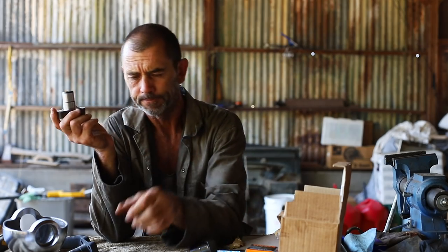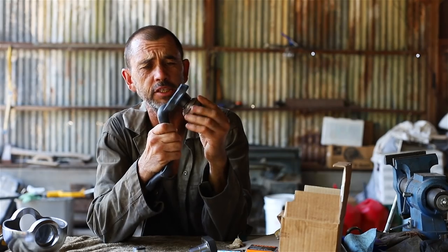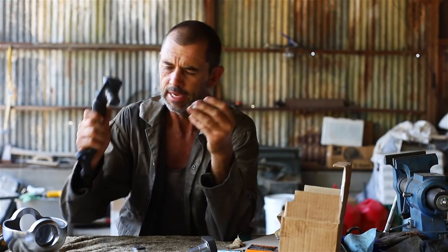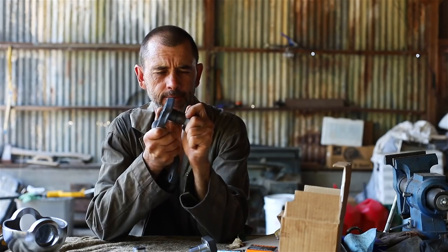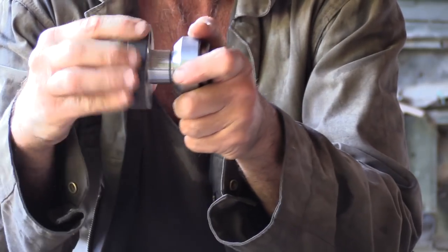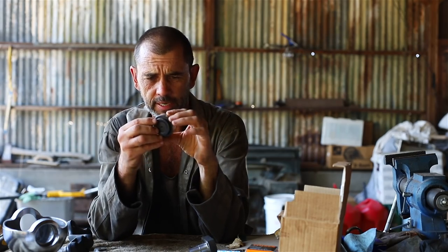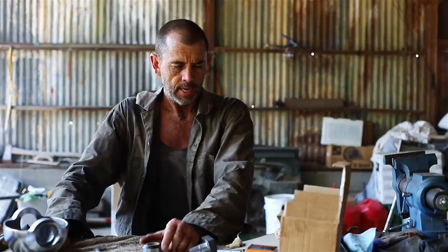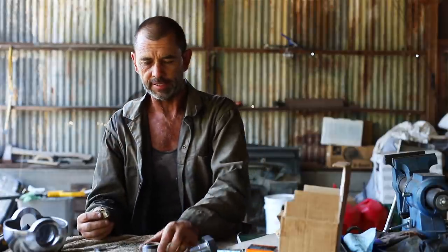And another mystery is that here we have our original, and the Railko bush slots in there like that, and pivots. It's a snug fit, but it's loose enough. However, with the new Railko bush, nothing. Huh? This one here, however, slots in fine. That's a real WTF moment right there. So, we're going to have to do some modifications here. And I have an idea that involves a last piece of coarse grained sandpaper.